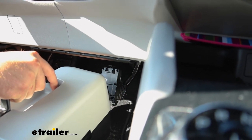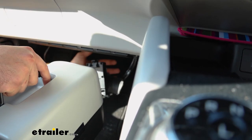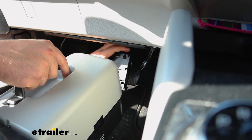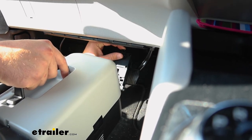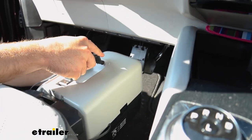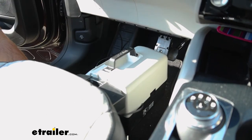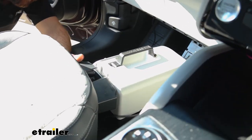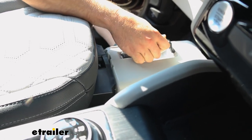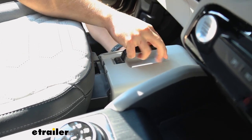We'll set our system in place. We'll slide it over top of the brake pedal. You want to stay away from this arm if you've got one. If it's centered, you can usually stagger the fingers over it and then push this button. It'll grab on to the brake pedal. Make some minor adjustments, make sure that it's pushing straight. This is when you'll adjust your seat. So since we're using that lower bracket, you want it to sit like that.